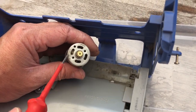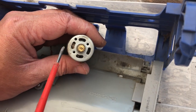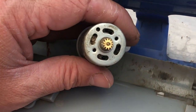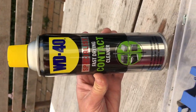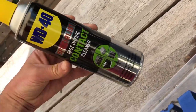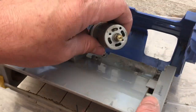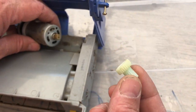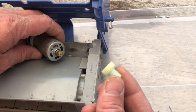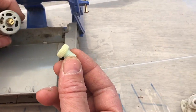You can see there's a lot of fluff and dirt in here. I suggest getting a vacuum cleaner and sucking all that out just to give it a good clean. I would then recommend spraying in there with some WD-40 contact cleaner to give the motor a good clean out. The best grease for the gears is a bit of white lithium grease — not too much, just smooth it on the gears.